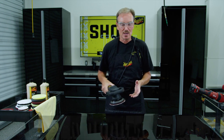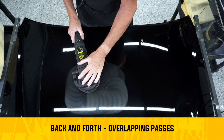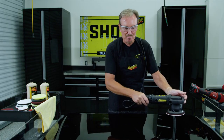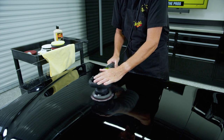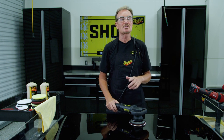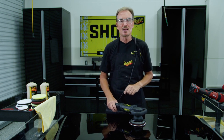The last of our five user variables is probably the one that has the greatest similarity between the two tools — the size of your work area. Generally we talk about working in the width of your shoulders and using back-and-forth overlapping passes. That's identical whether you're using the DA or the rotary. The downside to really growing that area is that if you start working a really big space you're just not spending much time in any given area to remove those defects. Work the width of your shoulders, mimic that in the depth that you're going, and work in those overlapping strokes — both tools, exactly the same.